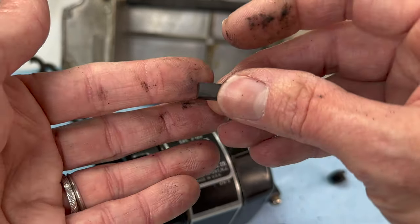Next, we have two screws we need to loosen on the top — one here and one here. They're both left to loosen and they're very long, so let's just take them out. It looks like somebody's messed with this motor already — do you see the damage on that screw head? I want to make sure I'm using the best bit I possibly can. The other side turns easily, so we'll get the easy one out first. This one has damage too, which makes me wonder what I'm going to find inside this motor. Hopefully nothing bad — the commutator didn't look too dirty.